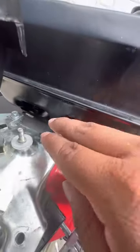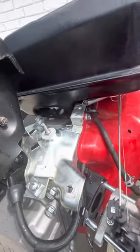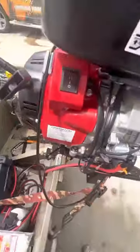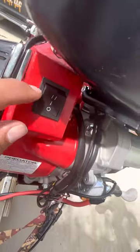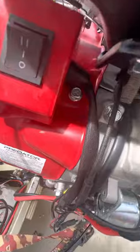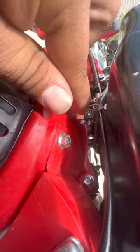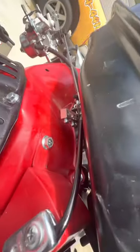I put the spring where the old cable tie was holding, just to get the tension from holding it this way. Then I ran my throttle through it, through here, and out the back. I went back to Home Depot and got one of these little clamps. I drilled it on to where this is at. I did take it off to see where the wire is running so I wouldn't tap into any wires — all the wires are basically below this down. But check with your own Predator if you're going to do this; you take that screw off and that screw off to check. I bought an electrical wire clamp and ran my throttle cable through the hole through the rod, ran it through here, tied it down. And as you can see, now it pulls this way.